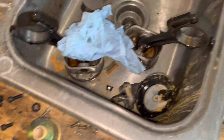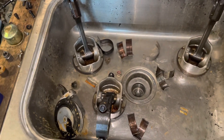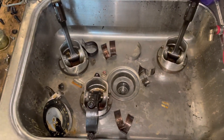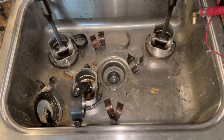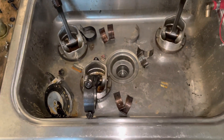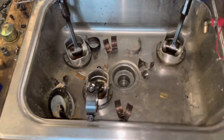This damage in this engine was not due to lack of lubrication — it wasn't due to running out of oil. It was due to detonation, just hammering these bearings and lifting the cylinder heads off to blow the head gaskets and destroying the bearings. The main bearings don't take as hard a blow as the rod bearings do when you have detonation. So if you have an engine with a lot of rod bearing damage and very little main bearing damage, you're really looking at detonation.